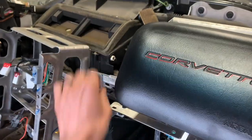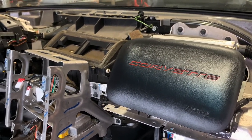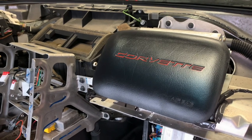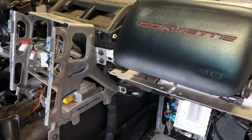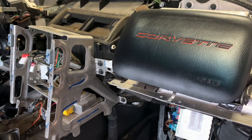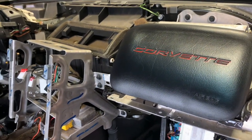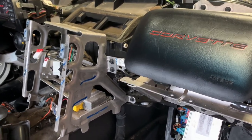The other thing I'm going to do is pull the heater box, which is back here. I've got a separate video I did with a different car on how to do that specifically. That's honestly the worst part of pulling out the interior - it's kind of a pain to get to because you actually have to get behind the intake and unbolt it from the engine side of the firewall to slide that thing out. You've also got to get the carriage out of the way so you can pull it. But I'm going to do it because it's a fair amount of weight and I'm not going to run my HVAC at all during races. When the cage goes in there's going to be a crossbar coming down here someplace, and once that crossbar is in it's next to impossible to get the heater box out without using a sawzall to cut it out. So I'm just going to do it now even though it's kind of a pain. Check out that video - I'll link to it at the end on how to get that out.